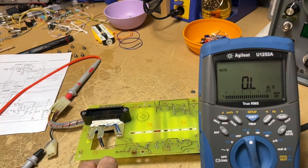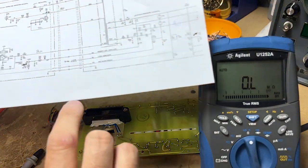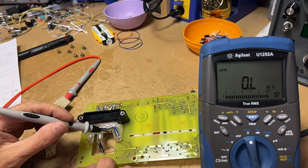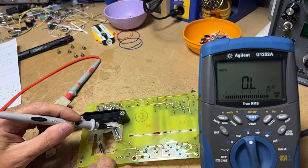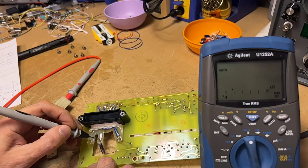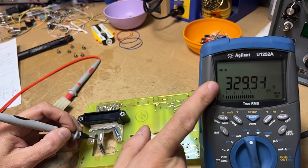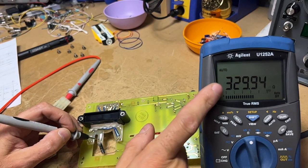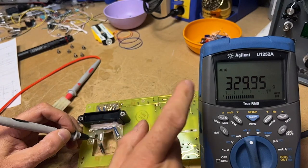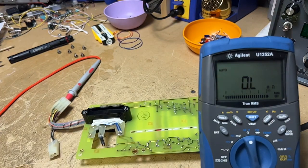The 4KV tap connects through this high voltage diode CR1 right here. We have to take that reading right on the transformer itself since it's coated with a soft clear silicone insulating material — you need to puncture that insulation to get contact. And there we go — this is the full winding of the secondary transformer and it reads 329 to 330 ohms. Much less than the 900,000 ohms I was reading on my transformer. That's some confirmation that this replacement should solve the problem.